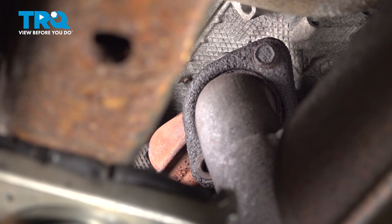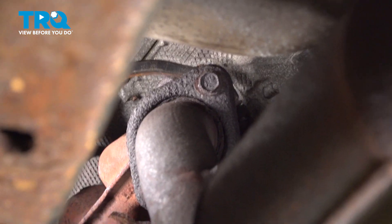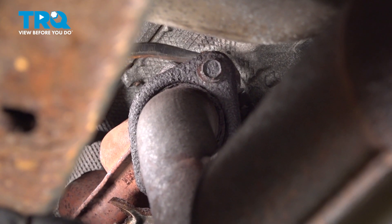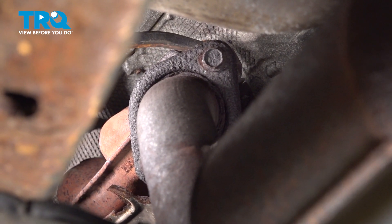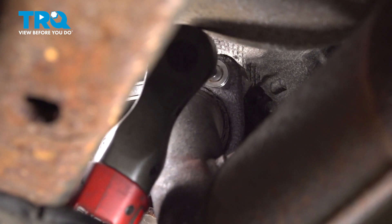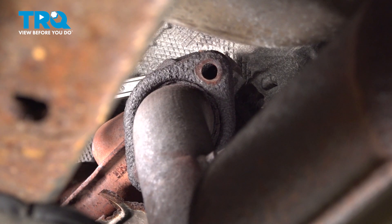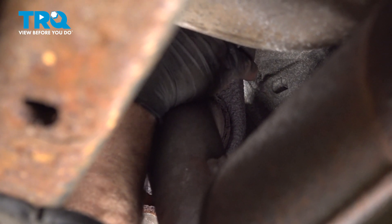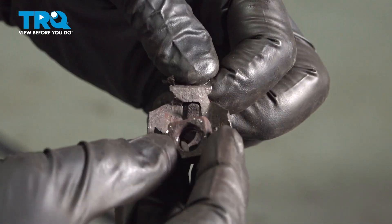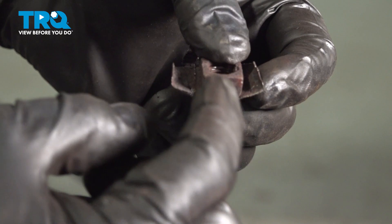Remove that nut and bolt, then we'll do the same for the upper. On our upper bolt, we had that little metal locking tab that was supposed to hold the nut in place. It was so rusted it broke, but it's still hanging on, preventing us from getting a wrench on the nut. So we need to pop the rest of it off — just using a pry bar to tap that tin piece of metal off. This retaining tab was rusted and was not holding the nut anymore, so we had to get it opened up to get our wrench onto the nut.